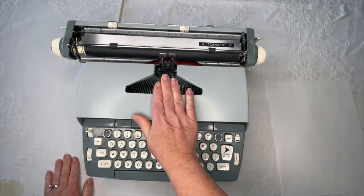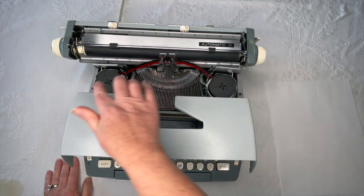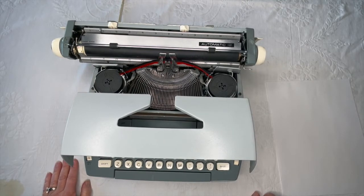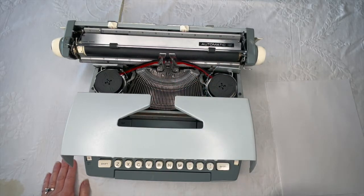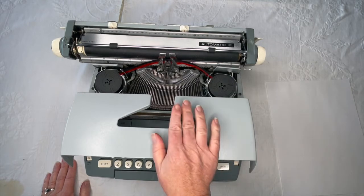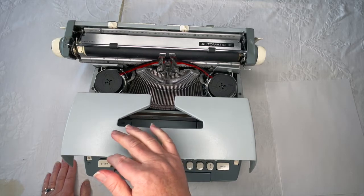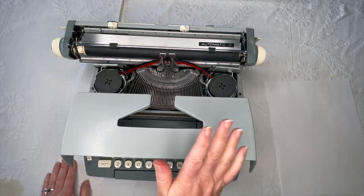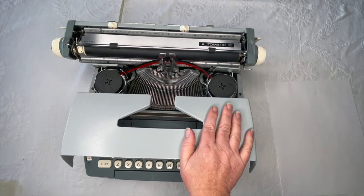Okay, so now let's open up the top and you just simply pull forward on that, and inside you're going to see your ribbon. We've put in a universal ribbon on this typewriter. Black is on top, red is on bottom. Please pay attention to how it's threaded through the guide wires. There is a photo of this, and if you click the product listing link in the description below, it'll take you to view those photos. That's a great point of reference if you have one of these, and so you can just bookmark that.